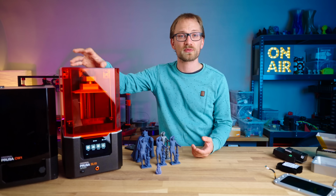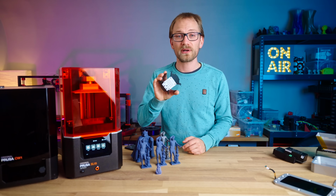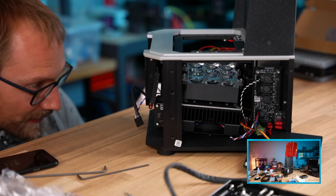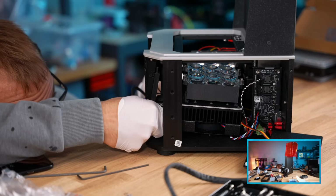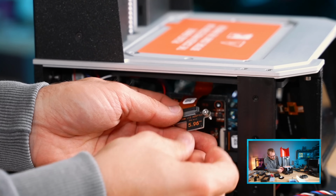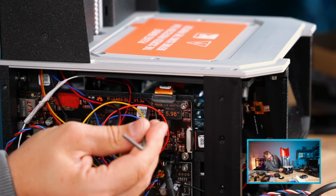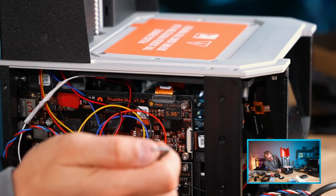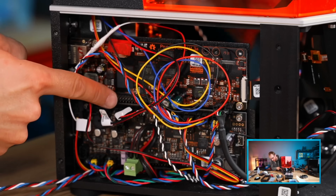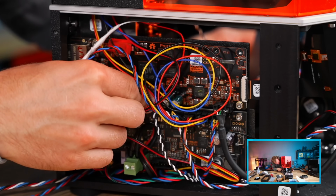It's a super tightly built printer, and replacing parts like the LED assembly in the bottom, this is the original one, with one that takes up almost 3 times the space, and then having to awkwardly attach that to the existing mounting points with the printed adapter, it is super finicky. Also, plugging the new hardware into the existing mainboard uses 2 adapters. One adapts the little Lego style connector to the FPC cable of the new screen, and by screwing down that adapter PCB, you're putting so much pressure on the connector if you just barely over tighten it. That connector is just not made for that. Then this cable down here has a lock-in connector, and because the spot you need to plug it into is just a plain straight pin header, they give you this printed adapter that lets you clip that connector to something.